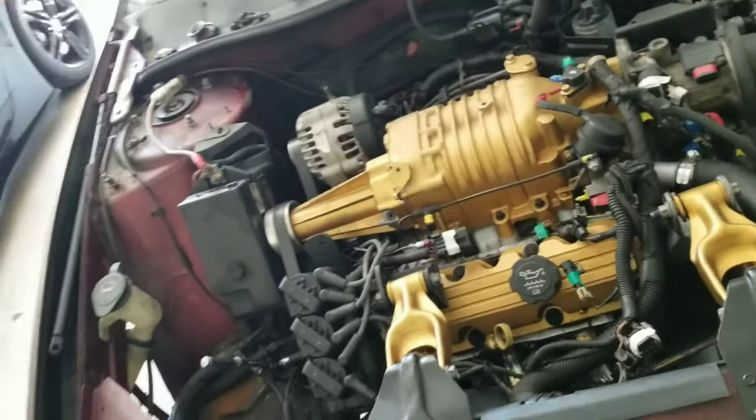Next, we're going to take off this radiator hose. It was kind of stuck, so you've got to wiggle it and all that. Just take off the radiator hose — I'm not sure there'll be much fluid in there since we drained it, and it's the top one anyway. If anything, we'll get fluid out of the lower radiator hose. Just kind of swing it out of the way and tuck it under there.